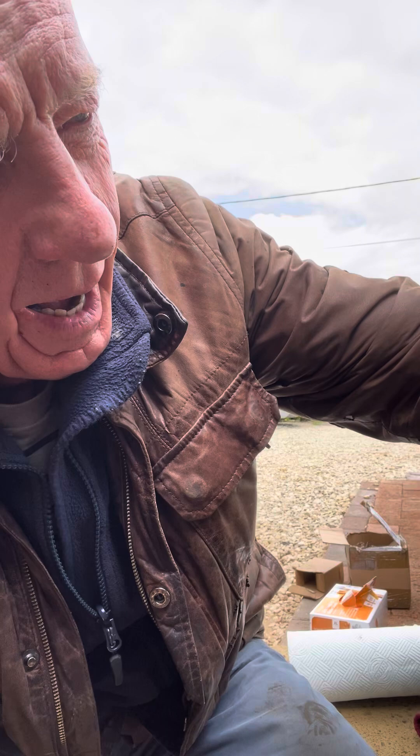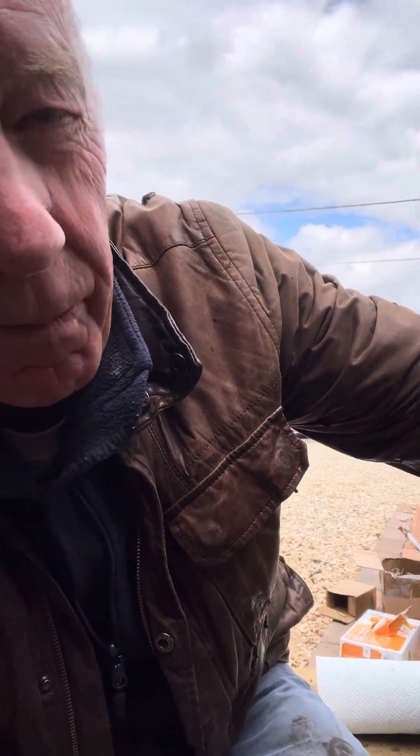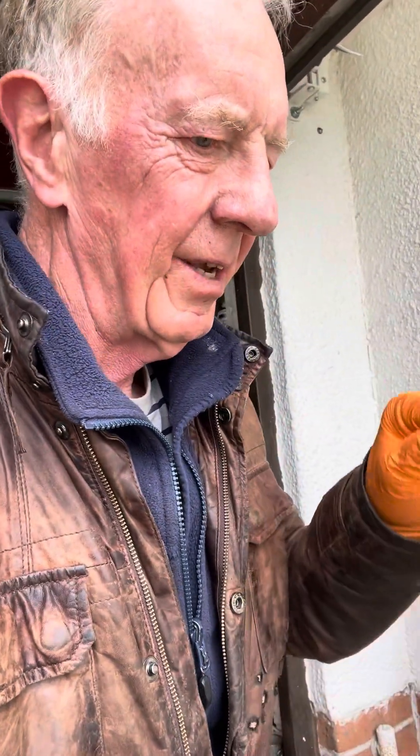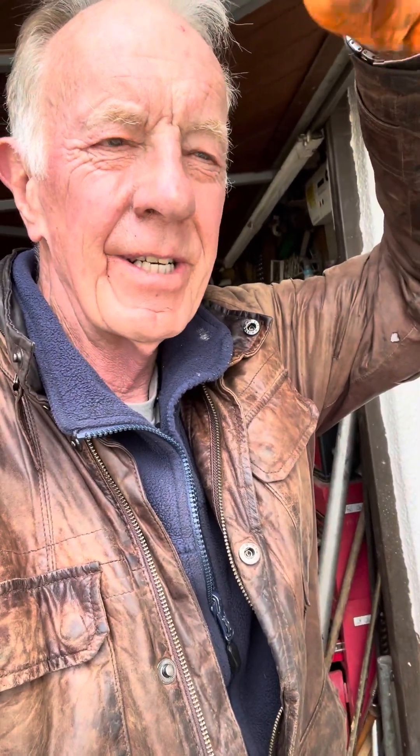Using the tap I just ground it in slightly just to take the top bit off, which had obviously been slightly damaged. I found one of the tap sets - it was a similar thread to the actual bleed nipple. And I was able to, after faffing around for ages trying to get the bleed nipple back, just put the tap in and do the first bit using a handy spanner, just to take off that damaged edge. Then I was able to get the bleed nipple back again. So that was a relief.